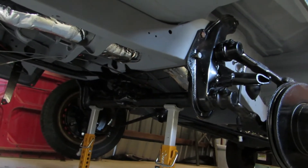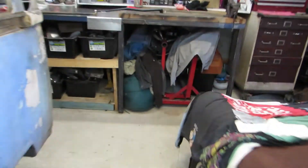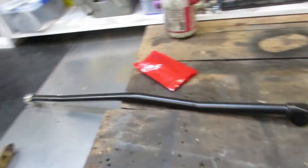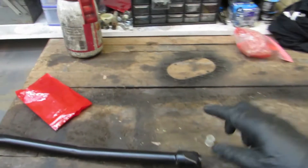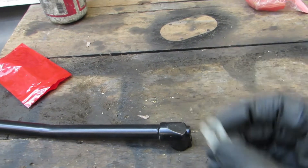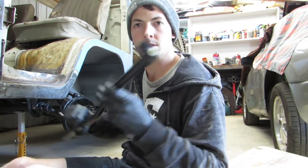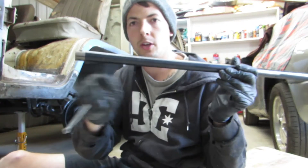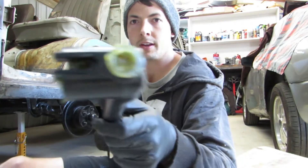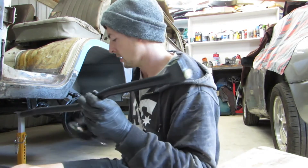I've got the gear shifter linkage, I'll chuck that in now. So I'm just going to grab the tools up here on the bench. We have the gear selector rod and then we have the new bush that I just pulled out. This one just gets pushed into the end of here - chuck that together. I cleaned off the sticker from this end and got this end all lubed up, both in there and in the bush. When in doubt, lube up.